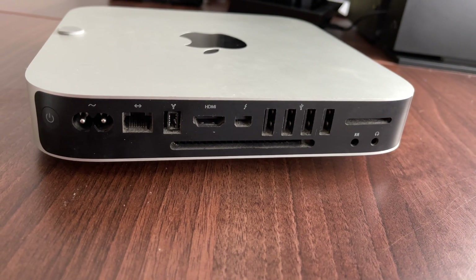You're not screwing anything in — they just effectively slot in and that keeps the drive in place. And then once you've got the SATA ribbon connector plugged back in — it's just that little bit awkward — that's why I've just stood the Mac body up and then I'm trying to push the drive forward. It slots into those two holes; you'll know when it's there, you don't need to force it. Just wiggle it gently and eventually it'll go in, then just push. I've got this little plastic spudger thing to push the SATA ribbon connector back onto the drive. And then the drive's in place pretty solidly.